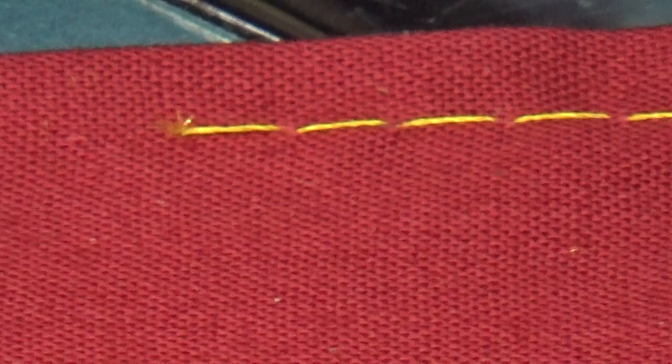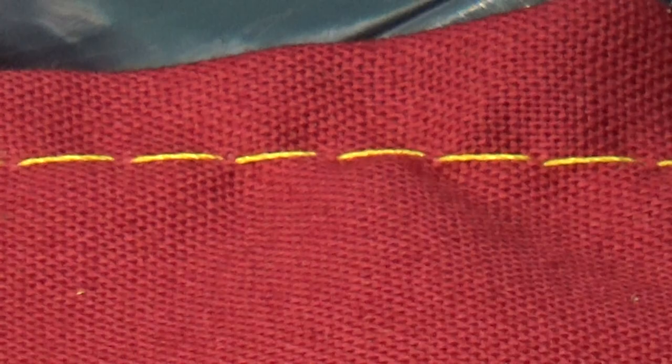So I think what I just did, and just very, very slightly backing off that upper tension so that it's not quite as poppy, I think is the right thing to do. But that is absolutely a page 34, if not a page 34 plus stitch on this 100% cotton. I don't even need to go past it again. You can see that very easily.